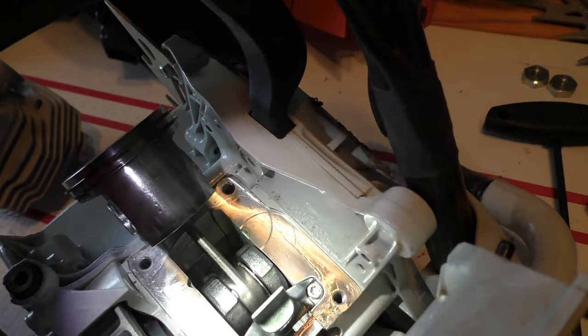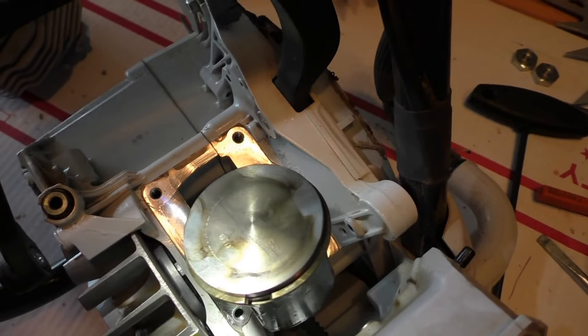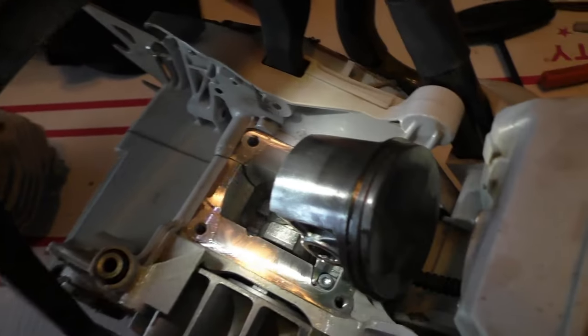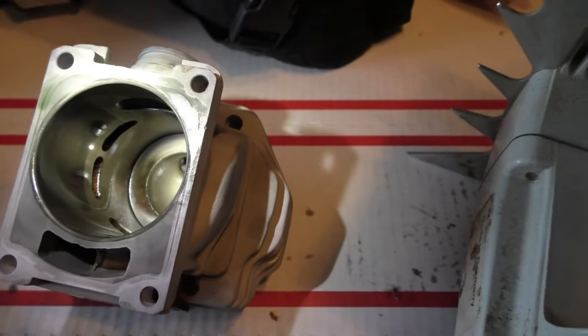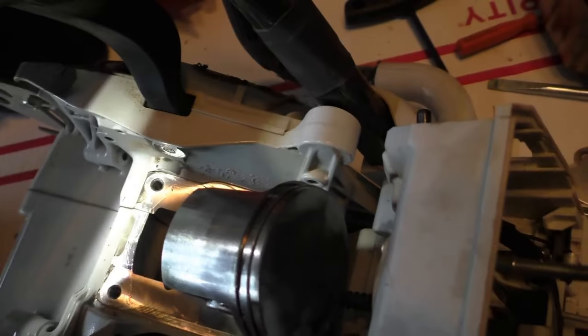Alright, here's the Husky can gas. Definitely less oil down in the crankcase. Wash pattern is lighter on the top of the piston. Don't really see any oil down there. It's not necessarily dry, but there's the inside. And we'll check all these out at the end. The main thing I want to do is look at the crankcase after each time, because that's going to change. The cylinders we'll have all at the end. But, alright, back to cutting.